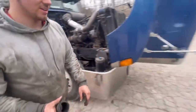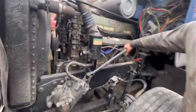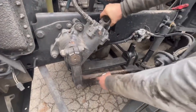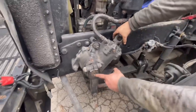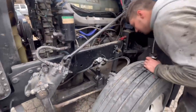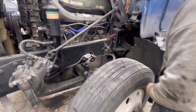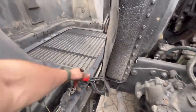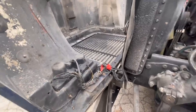Come over here and make sure the steering arm up here is tight — just wiggle it. There's slack here but no slack right there — you want to make sure it's tight. If you've got slack you can pop it out and check the brake, obviously both sides. Check brake lines and look for any kind of leakage anywhere — any hoses rubbing other hoses. Check your lights too, and make sure nothing is chafed or looks like it's about to come loose, because once it wiggles it can come loose and you'll lose your lights down the road.